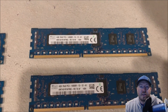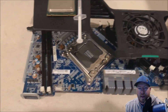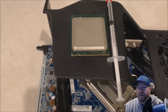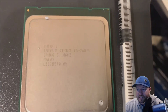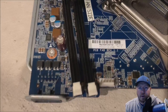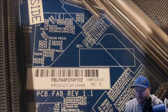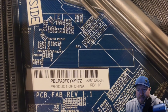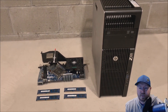We're matching the existing modules that are installed in the system board — so you may have 10600R modules, go ahead and match them. Here's our CPU. We're going to install an E5-2687W eight-core CPU, and that's exactly what we have already installed on the system board CPU. Here's a little sneak peek at the part number for the riser — again the part numbers are located on GreenPCGamers.com, search article Z620.